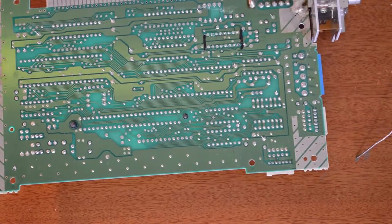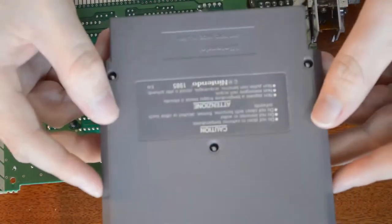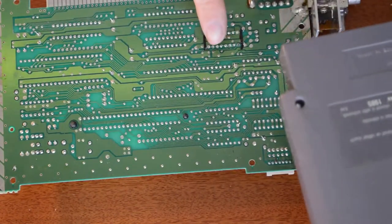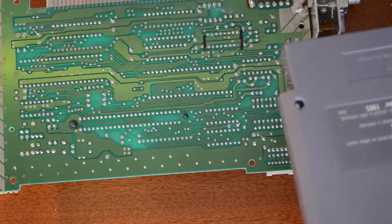I'm going to turn on my hot air station and get it nice and toasty. There's another lockout chip inside the cartridge — it's set to ground so it's a key, and this one in the console is the lock. What we're basically going to do is make this one the key too, so it unlocks the system. Basically you're just using the system to unlock itself. Now I'm going to flip the board over and go over this with hot air. Some of the larger traces take a bit more heat to heat up. The smaller ones along the top are probably already molten but these points along here need to warm up a bit more.